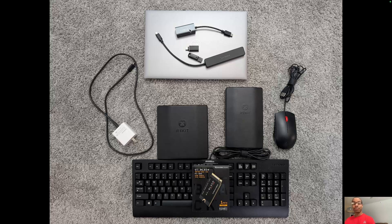When the installation completed, there weren't really any drivers included that worked with the Surface, so the Wi-Fi card did not work. Since there are no Ethernet ports on the laptop, I needed to use one of the USB-C ports and convert that into an Ethernet port to actually connect to the internet, install updates, and therefore install the drivers. Same thing with this little Sabrent dongle.